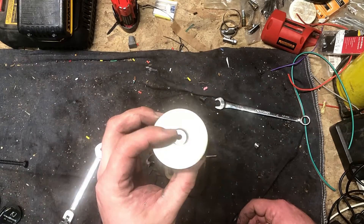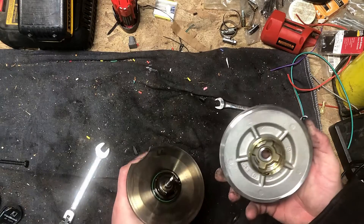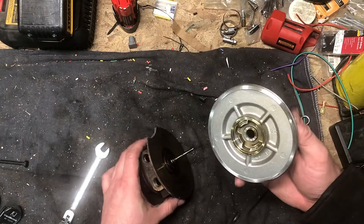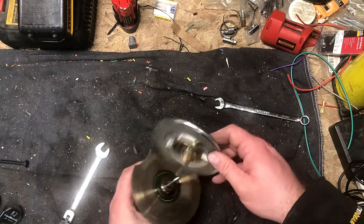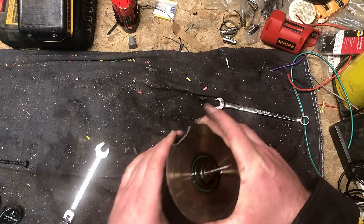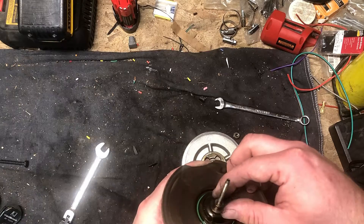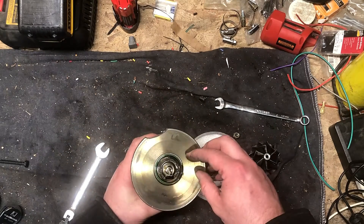Marvels of modern engineering. So this would be the back plate — this would be the intake side. There was an O-ring that I believe sat here that keeps everything in. This backside seal here would be the part that if it goes out, you're going to have a bad day, because it's going to suck all the oil right through your engine.